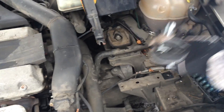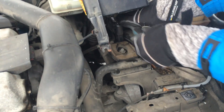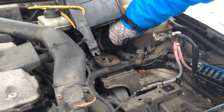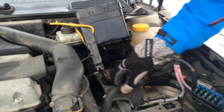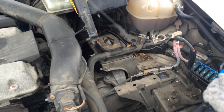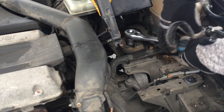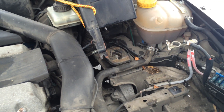I dropped the socket but found it on the ground. The rear ones are a lot harder. This one doesn't really want to come out, but just be patient. Now we have to remove the big nut in the middle — that's an 18mm. Just use a bit of force on that one, and it came off quite easily in the end.